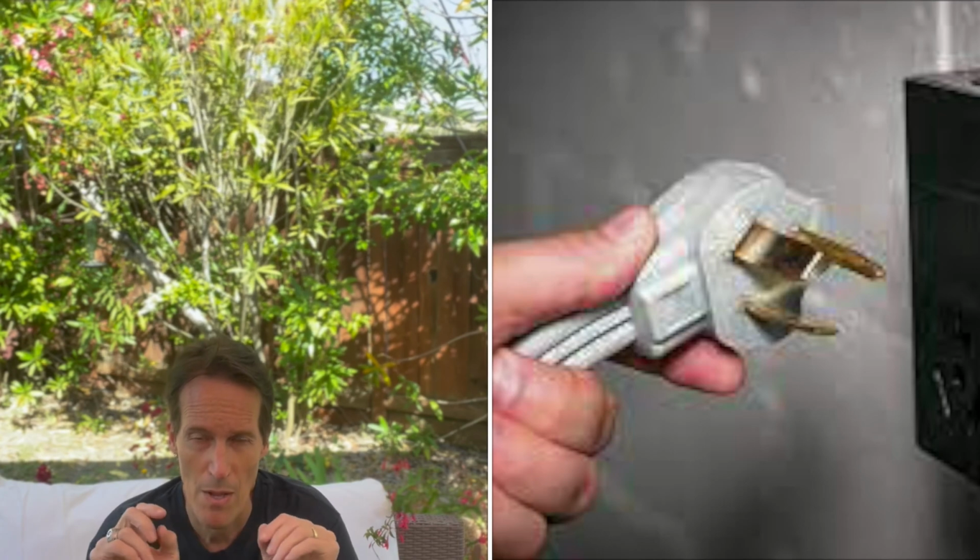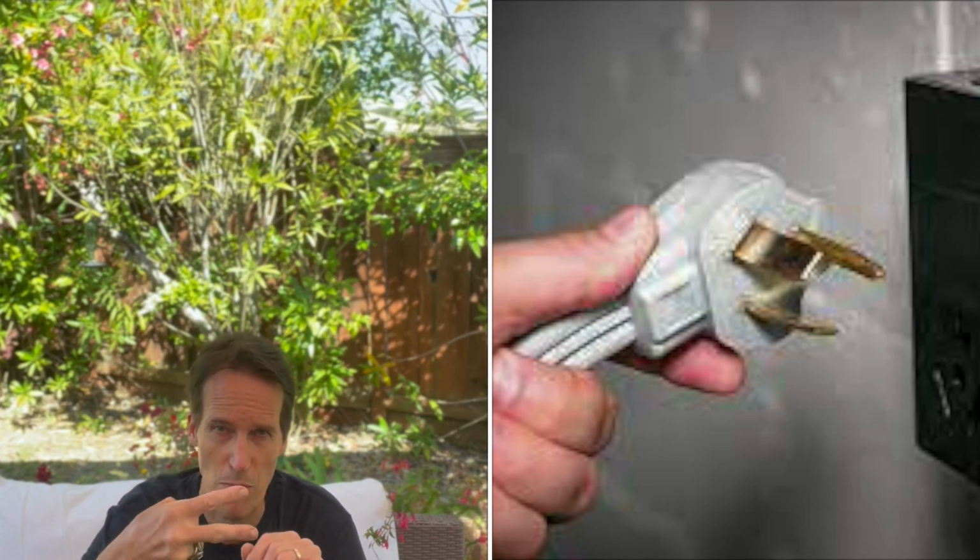It might just be that the breaker in the breaker box has tripped. What's interesting with the electric dryer with 220 volts coming in, with that big plug behind your dryer, that type uses 2 of your home's breakers to send power, one for the tumbling and one for the heating. So it could be that the heating one has tripped and is no longer sending energy. So it might be as simple as finding the 2 breakers for your dryer in your home's breaker box.